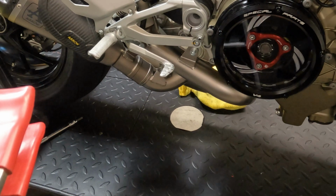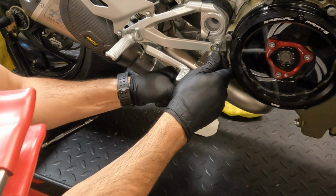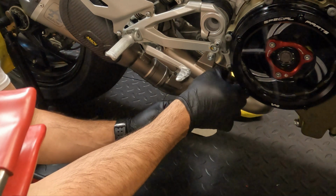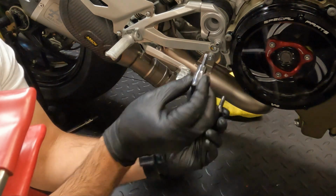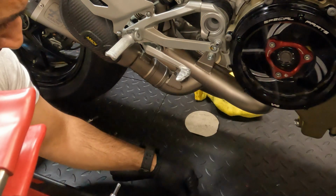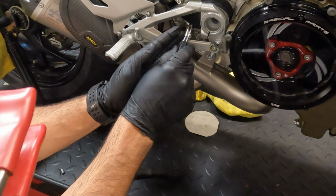All right, so to remove the rear set, you're gonna need a 6mm Allen, and that'll break these bolts free. You got basically 3 mounting bolts, 2 down low, and this third, which is like a pinch bolt that you're gonna need to loosen. These other 2, you're gonna need to pull all the way out. Looks like there's some lube on these bolts. Same size. We'll get this third one out. Don't think I'll have access. All right, so I just got a 6mm on a small ratchet.